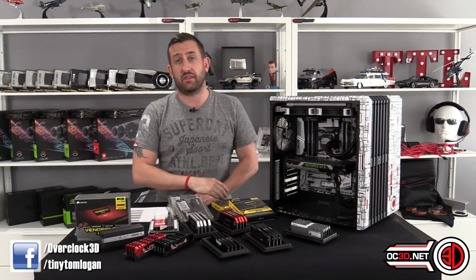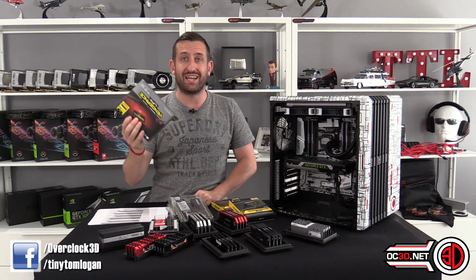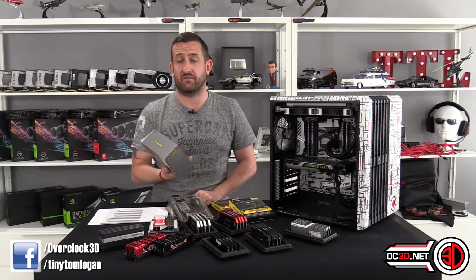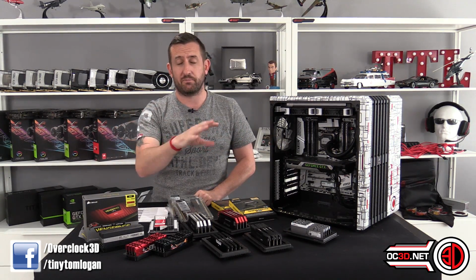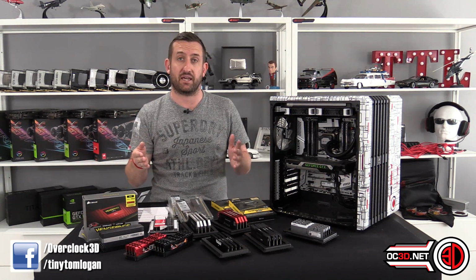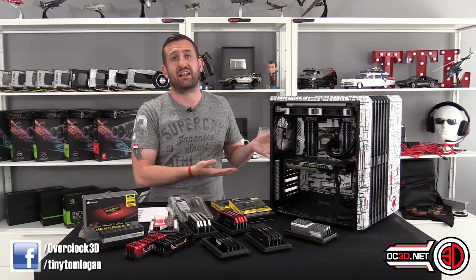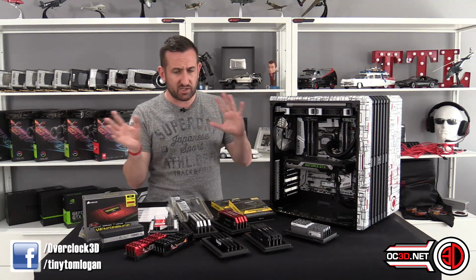So if you want to get a 3200 megahertz kit with your Titanium, at the point of this review going live, only one kit works. And that to me is a little bit nuts. That's not the way to be, trying to get £300 out of someone for a motherboard. Think of all the poor souls out there that have bought this and have gone and bought their favourite memory brand. If they've gone 3200 megahertz, how many people have sent the board back saying it's faulty, when really it's not faulty, it's just being let down by a horrifically picky BIOS, because that's what it all comes down to in the end. So right, we've got that.